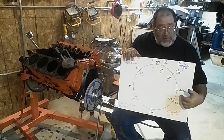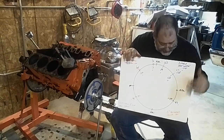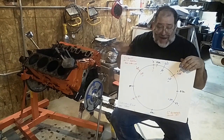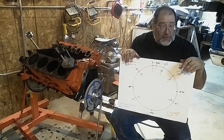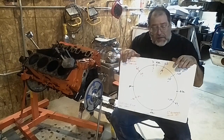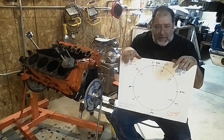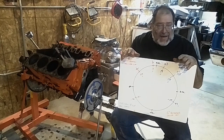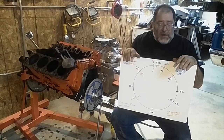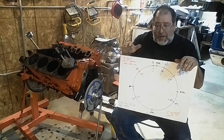This cam isn't very big, so this point really isn't very far down. You can run a much bigger cam — one of my favorite cams is more like a 230 duration over a 200 duration. Now, camshafts are not super sensitive. A couple degrees one way or another isn't going to really change how the cam behaves. You've got to start doing 5, 8, 10 degrees — either more duration or moving — before it really has a big impact.